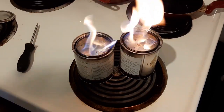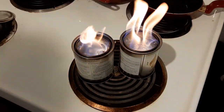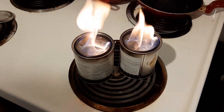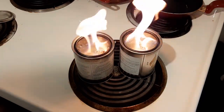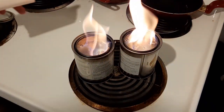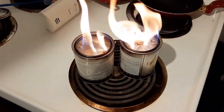It's been just a minute and the carbon monoxide detector is already beeping, but I happen to know what the alarm sounds like from the test button — that's not the alarm. I think it's the battery. The old battery tested at 1.5 volts on the dot, which is concerning. This thing started beeping after probably several months of use on a really cheap battery. I put new ones in — we'll see if it does the angry beeping.